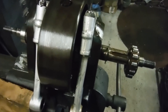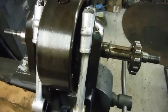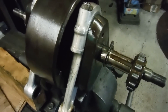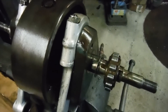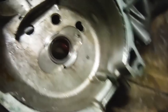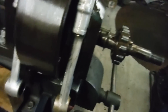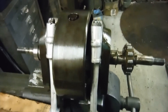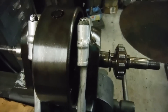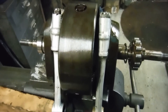It's supposedly only meant to have between one and a half and three thousandths of an inch when you assemble the engine, and obviously that figure could grow a little once the engine's done a few miles. This one had considerably more than that. I'll be making sure I've got all the right matching components when it goes back together. I can improve on the crankshaft end float by using a cup with various pre-selected shims fitted when I put the crankcases back together with the overhauled crank and timing-side bush setup.